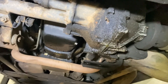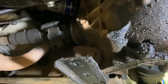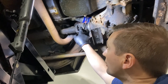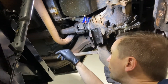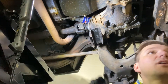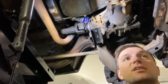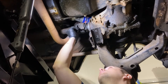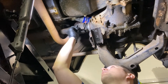Next step is to disconnect the U-joint that comes over to the front differential. I've made a mark on the cap of that U-joint and on the yoke of the front differential so we can put it all back together just the way it came apart. I've broken all four bolts loose — those were seven-sixteenths — and now we'll go ahead and remove these bolts so we can drop the front driveshaft.